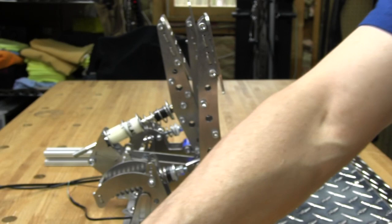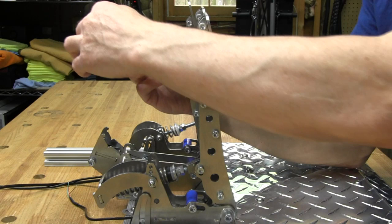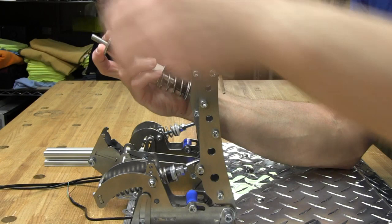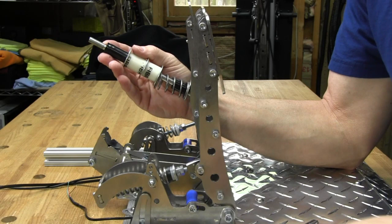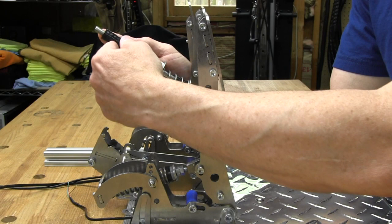The bumpers are actually made by a place called Fibrolast — that's the name of these bumpers, and there's an extra one in the kit. I'm going to put the spacers back on and keep everything from flying off. Once the spacers are on, I'll put the two washers back on. Remember there were also two original spacers that came off with the urethane bumper, so I need to put those back in the stack too — that gives me a total of four small spacers plus the one large piece.